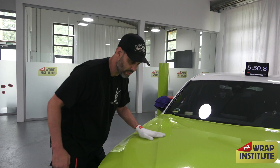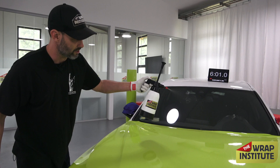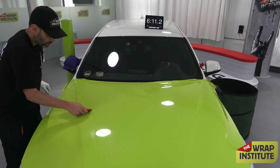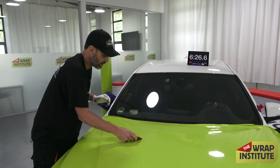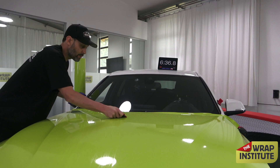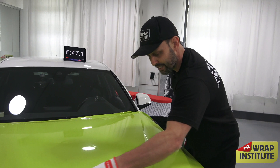Once I have that set, I take the material up to here. What I have left is the middle section. To avoid scratching on a wide section like this where I'm going to be squeegeeing a lot, I spray a little bit of soap and water on the surface. Because I have a special buffer that can get wet, I can squeegee back and forth — and it's super easy. The reason I'm not getting bubbles is most material today has technology called air egress and repositionable technology, so I don't have to hold the material off the surface.